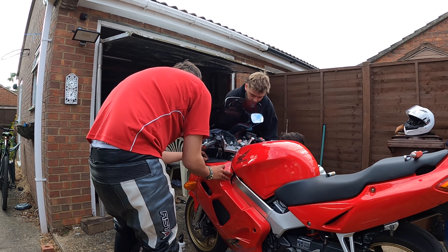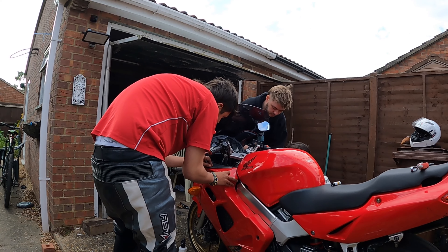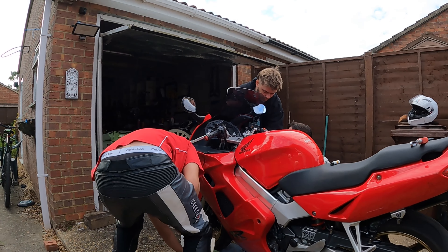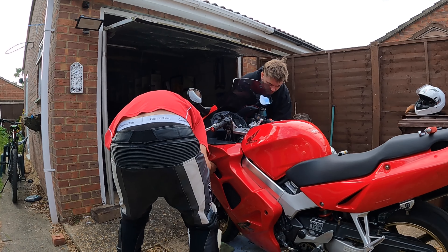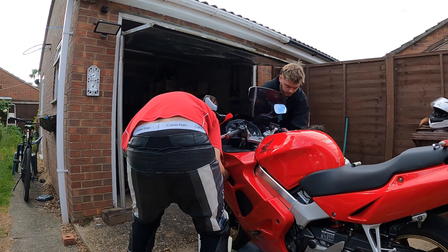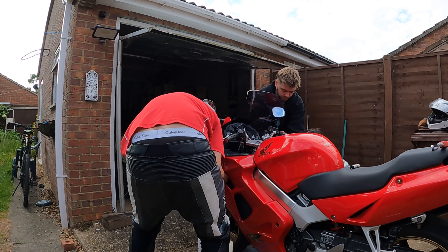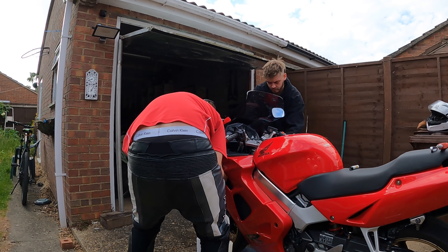The three side ones look kind of the same. The bottom ones are the big ones - big lug bolts with a big washer. The fairing's back on, really good. And we've sorted out the front forks because I had the bar raisers on there. We found out the front forks were on the softest setting, and no wonder it felt a bit wallowy going into corners.